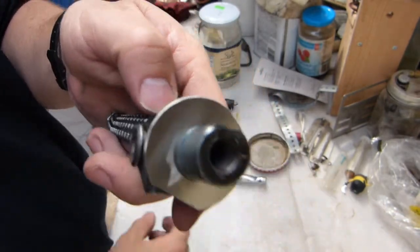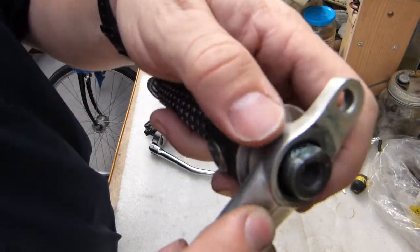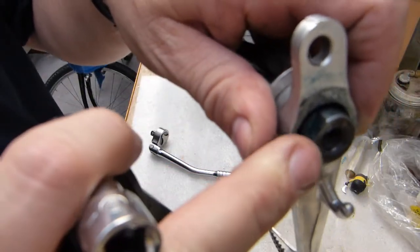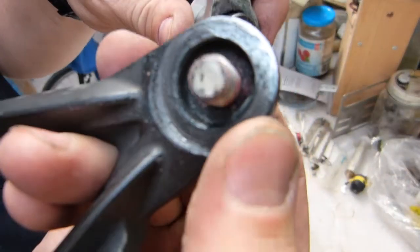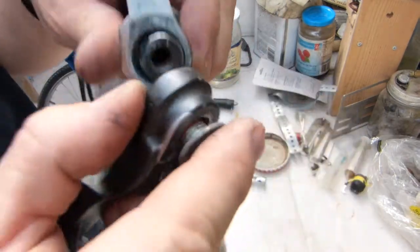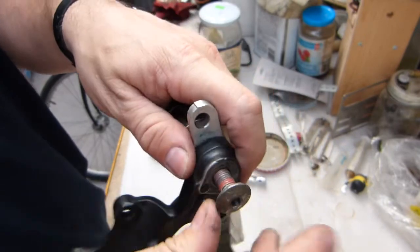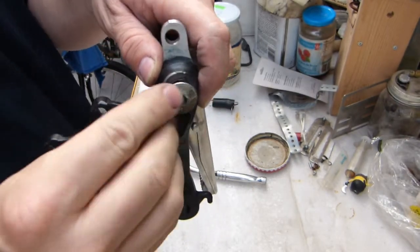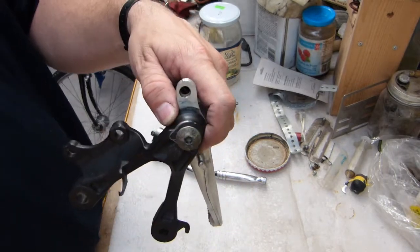Fairly straightforward, but this is your brakes. It's a critical component. And then this flat portion there, that keyway, should match the keyway in this bracket here, which is at my thumb, that flattened portion there. So these are together, and then this is a test fit, so I'm not applying thread lock. Yeah, this test fit should work.